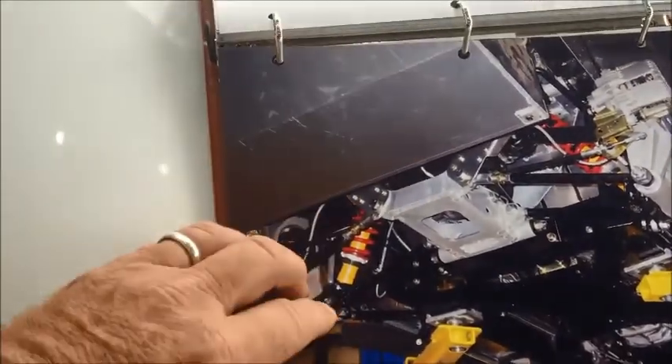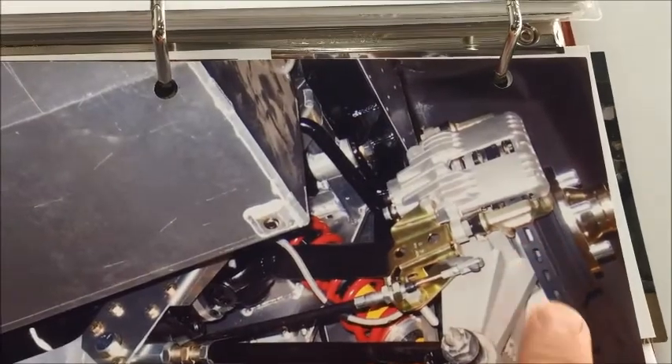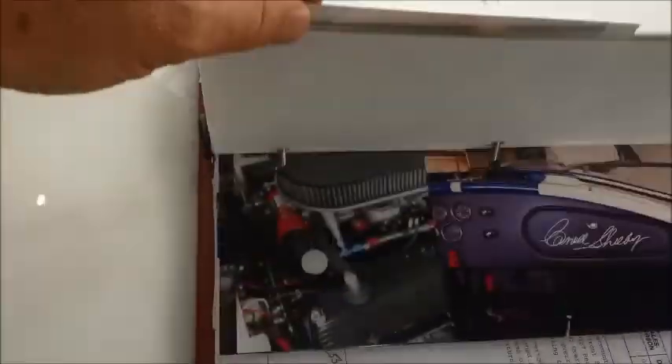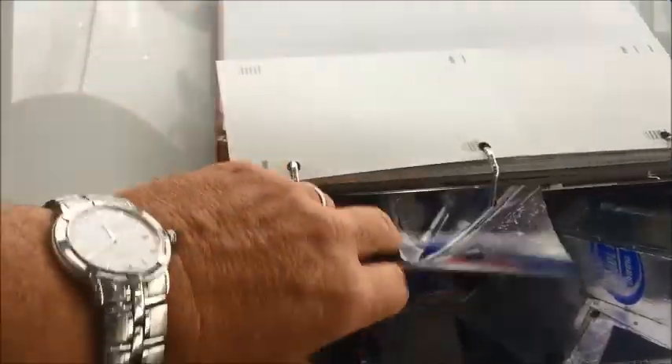The small block is nice too — it's a small block 402 cubic inch, but also very powerful: 525 horsepower with very little heat. Here's a big deal — these are the outboard brakes. You can see the rotors here. This is the outboard braking system for the rear end. Usually on these cars they're equipped with a Jaguar rear end, and the Jaguar rear end has brakes in the center of the axle, which really is not optimal braking. This car can go really fast, so you want the safety of those extra outboard brakes. There's a $4,000 option he checked when ordering the car to have those installed — first time I've ever seen outboard brakes on the rear end of one of these cars.